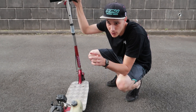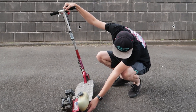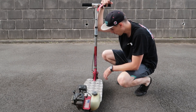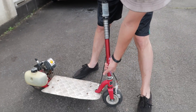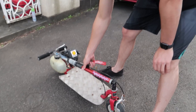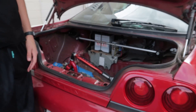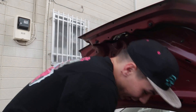I've adjusted the wheel so the drive shaft is touching the top of the wheel, so we should be able to push off and it should start without using the pull cord. One thing I figured out last night from the manufacturer's website is that this is supposed to fold down — so after using multi-grips to get the seized and rusted mechanism to move, we can now lift it and the whole thing folds down. This means we can put it in the back seat and take it to the track with us at Ebisu. May's going to ride this today if it starts — I hope it runs and works.